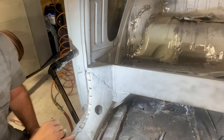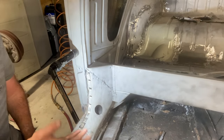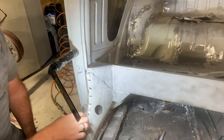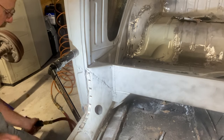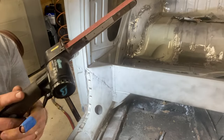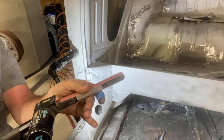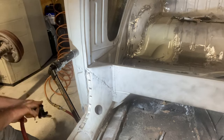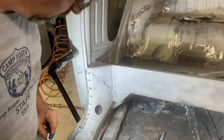So we're getting this cleaned up. The remnant of the old carpet, we still don't know what to call it, carpet clamp or whatever, has a bunch of spot welds on it. So I've ground through them with my Harbor Freight belt sander. Get in the habit of not setting it down this way, because if you reach over to pick it up while that's on the ground, it can take off while you're holding the belt part. I don't recommend that.